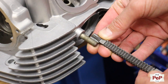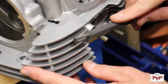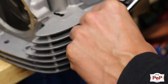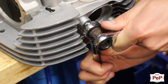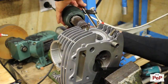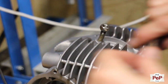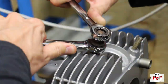First, I needed to remove the bent studs from the cylinder head. I once bought this file to repair damaged screw threads. It's an unbelievably helpful tool. I first tried to unscrew the studs with two nuts without heating the cylinder head. No chance. If you really heat up the cylinder, this will work. The aluminum expands faster than the steel, and this helps loosen the studs.